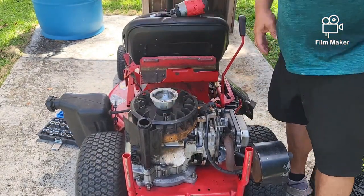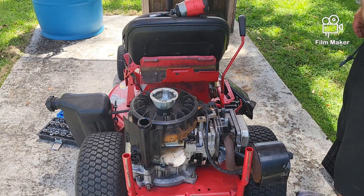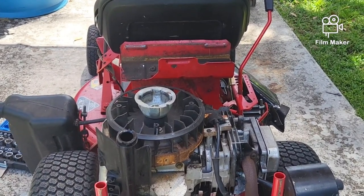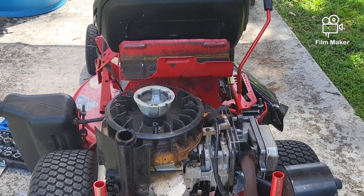Now I don't know that you'll be able to see it. I checked the oil - the oil is a little bit high, but it doesn't smell like gas. It looks like oil. So that's not going to be the issue. It's not overflowing enough to go into the crankcase. It is just flooding the carburetor at the moment.